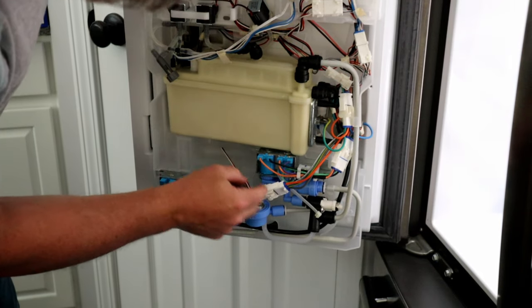To wrap this video — we ended up fixing our GE Profile Counter-Depth Refrigerator's Keurig K-Cup system. As you recall from the beginning of the video, if you pressed start heating it would just blow water everywhere out of the relief valves in the back and also out of the front dispenser. Changing out the tank actually fixed the problem. So if you have a similar problem, that may be your issue as well — go online, grab a tank, put it in yourself, and you'll be fixed.